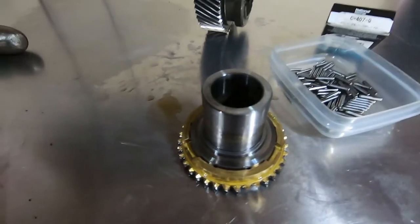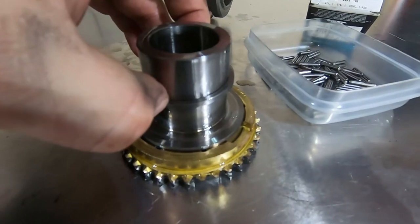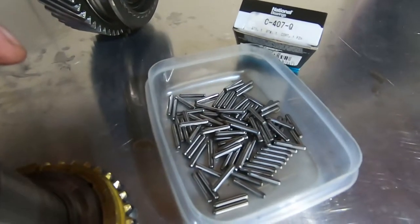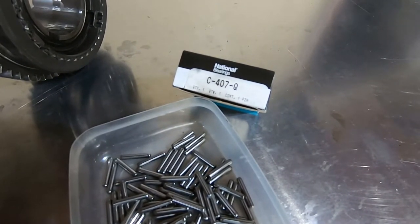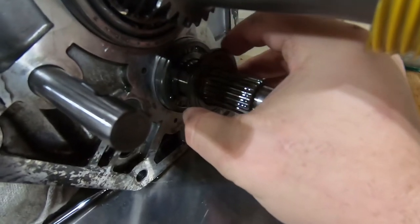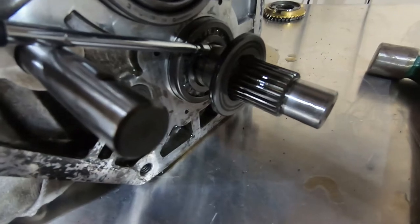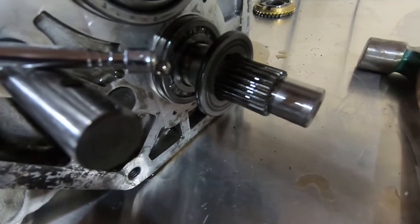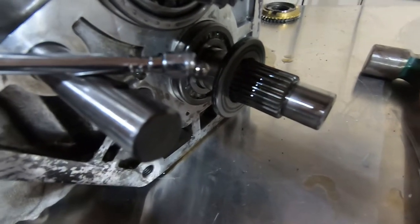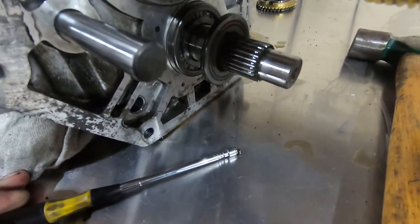The cone's out. One thing to notice is there's a spacer that separates the two rows of needle bearings — make sure you keep that. I'll leave it on here so when I put it back together I remember where it goes. Here are all the needle bearings and the part number in case you need spares. Down at the countershaft, there's a race that slides off and there's going to be an anti-rotation ball. This race is what keeps the needle bearings in fifth gear intact and not going into the countershaft bearing behind it — so don't lose this anti-rotation ball.